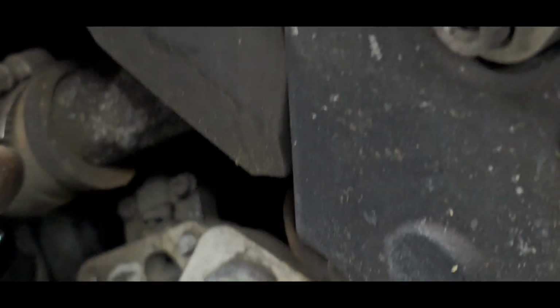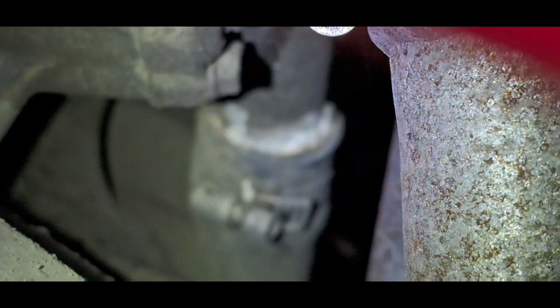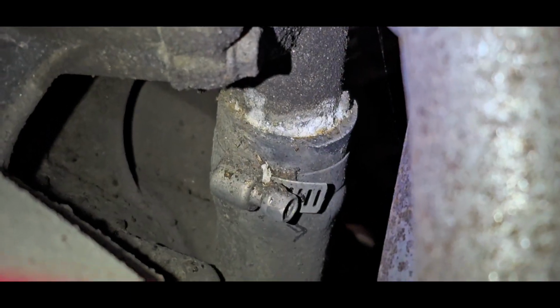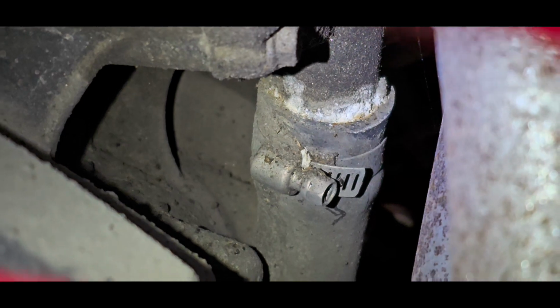Actually, just above here, this is your coolant hose. Was looking in at your upper hose. Where did it go? Yeah, okay, so right in there, this right here is a header pipe. Rusty as all rusty could be because it's not really been heated to temperature yet, but deep inside there, where the camera's unable to focus properly, is a coolant leak. Yeah, there you go. There's a coolant leak. So this is probably why the overflow bottle is empty.